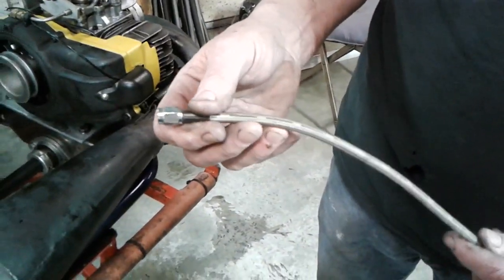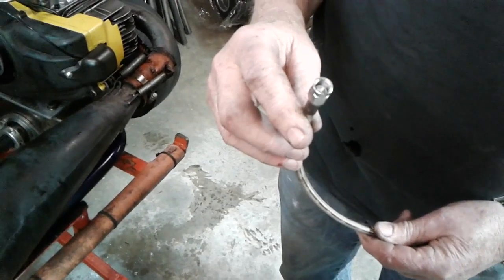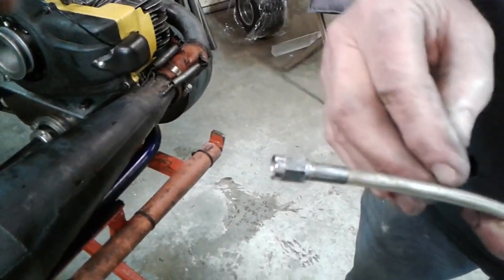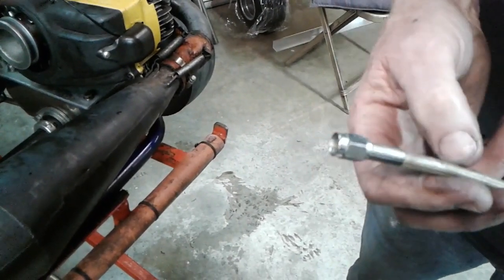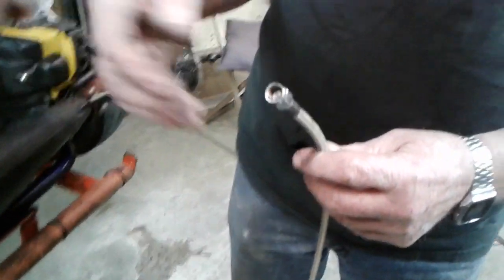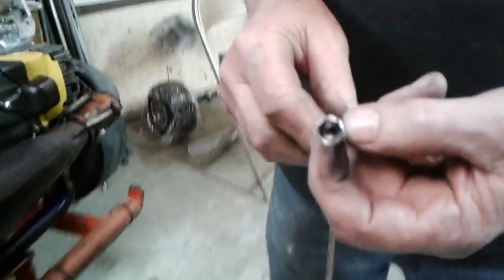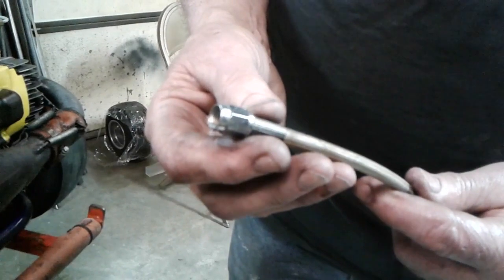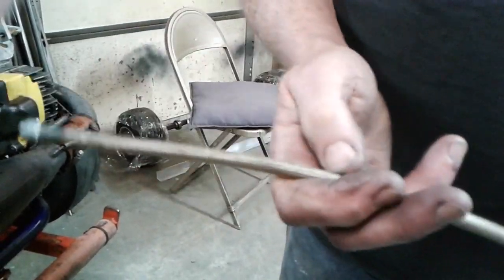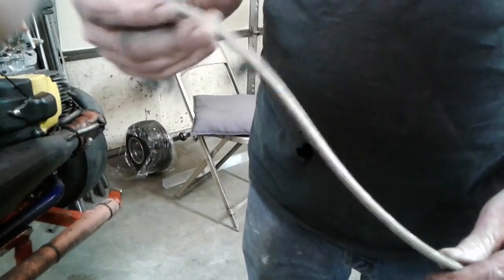On these carts, a lot of guys don't like that little white tubing — they've just got to have 3AN lines, just like we use on motorcycles and stuff, that screw on a 3AN fitting. What they don't realize is that underneath the plastic sheath and the braided piece of metal — some of it's plastic braided, some is metal braided — you have that same tubing inside with that little hole and little flare on it. The plastic line is put over top of that and it's all crimped down. All that outer coating is just an anti-wear area. This line's not any stronger or more blowout-proof than that line if you have the correct brake line, because that's what you've got inside.